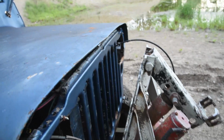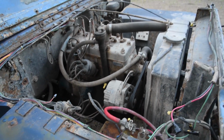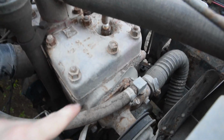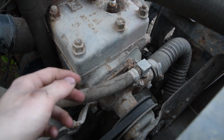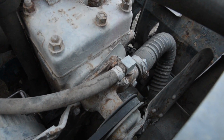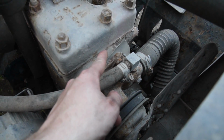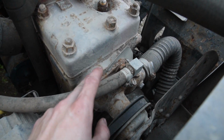We go to lift the hood. This is what you need to look out for under an engine bay. So number one way to tell when you're looking at a classified ad to see if it's a correct engine, here's your first clue. This water pump housing, now this one's kind of crusty and it's hard to see, and someone put this plate, I'm assuming, as a way of sealing the water leaking problem. But this plate is only flat from here to here, whereas on a CJ2A, it's flat from here all the way over. So that's your obvious sign.